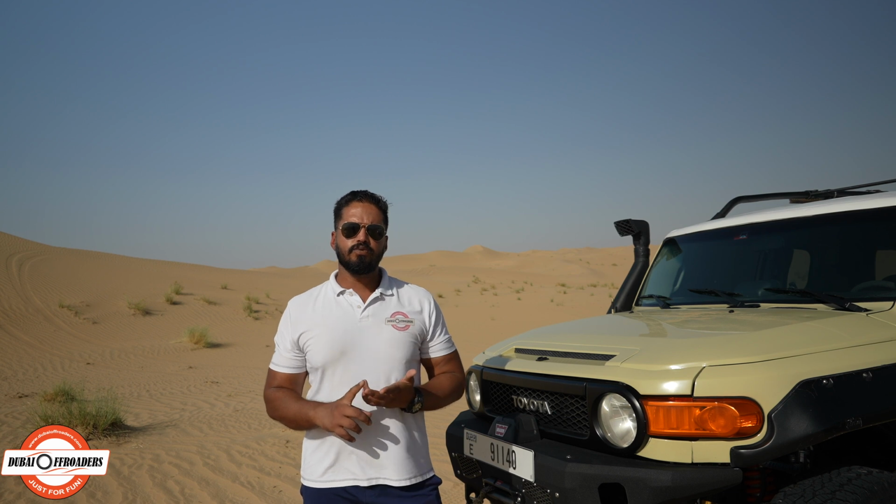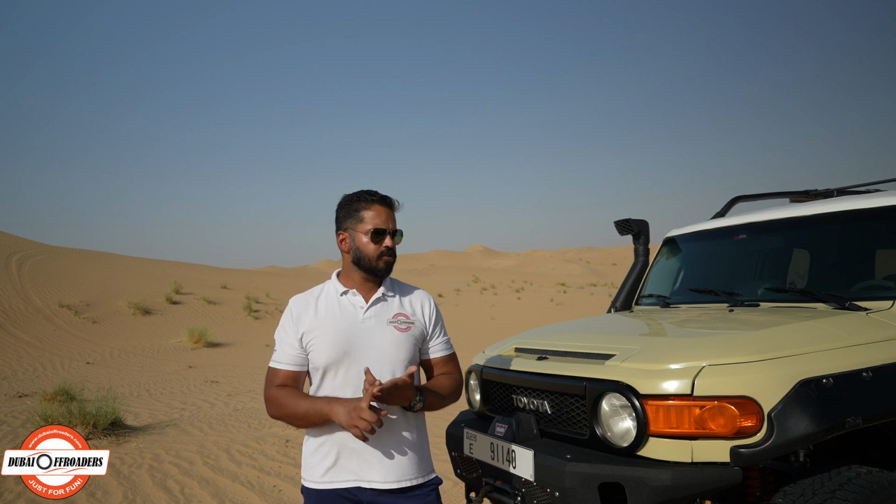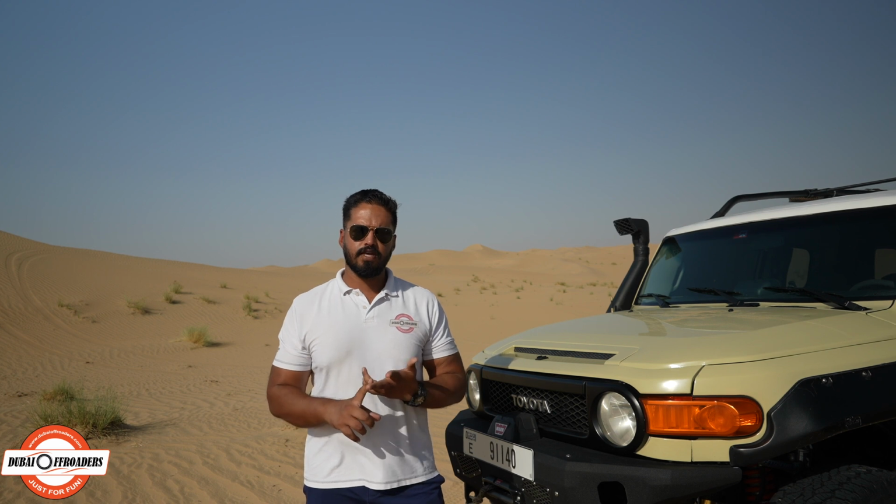The second thing that you have to do, now depending on what your transfer case is designed like, you are either going to be running on 4 high, or you will have to engage your central diff lock if you have an all-wheel drive car. So if you have a full-time 4-wheel drive car like mine, you will put it in HL, or you will sometimes have a button for central diff lock, and that will give you a great advantage when you're out in the dunes.